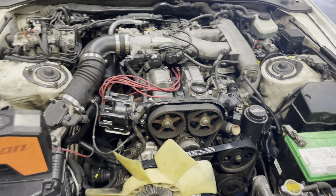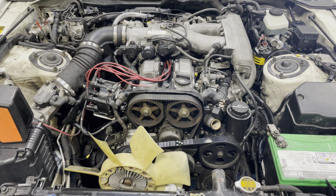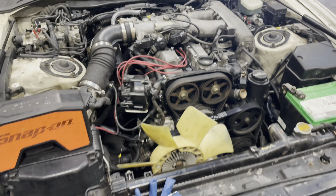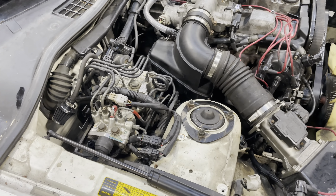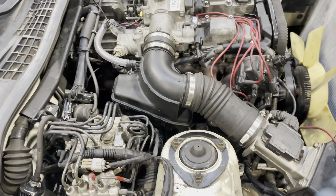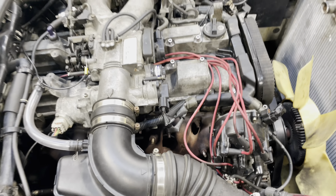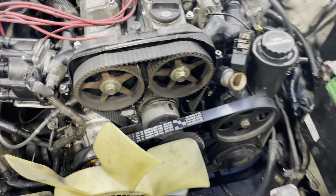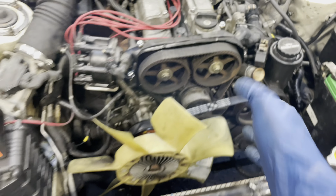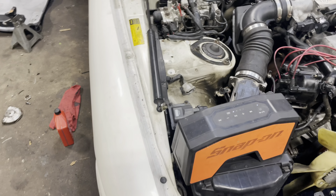So I couldn't figure it out. As you guys can see, we're getting backfires and stuff like that. All stuff that was telling me the timing's off. Everybody keeps telling me timing's off. I'm like, I did my marks, I put my things to zero, all my marks lined up. I knew it wasn't that. So I'm like, it's got to be something with the distributor.